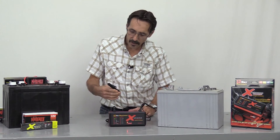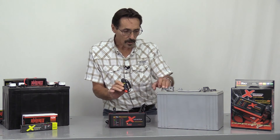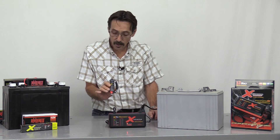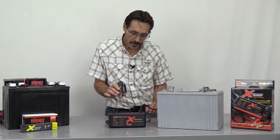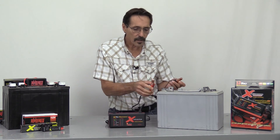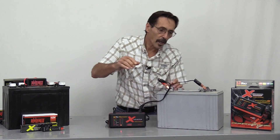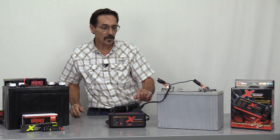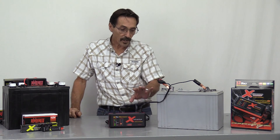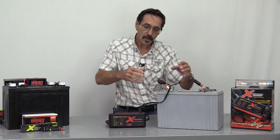To check your car alternator, you just start your car up and hook this up to the battery post. It'll tell you whether your alternator is overcharging or undercharging. This is a cool little item — we use this quite a bit. I'm going to go ahead and leave this hooked up, and I will get back with you guys on this. This is an extremely bad battery, so I'll let you know if this actually desulfated this bad a battery and turned those sulfates back into liquid.